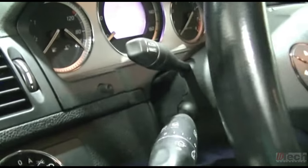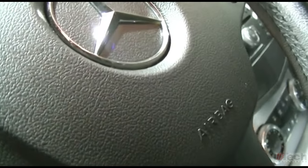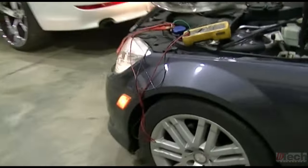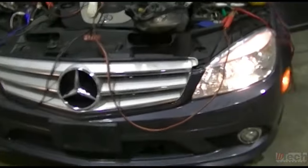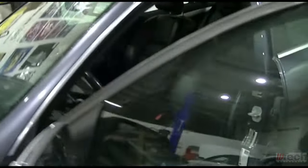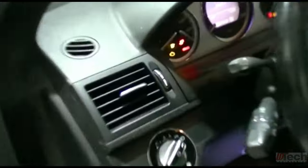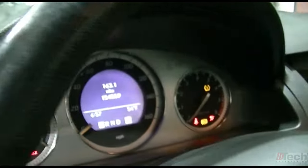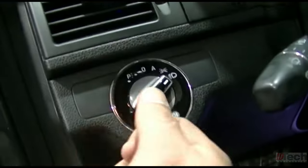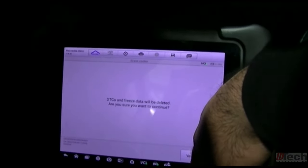Key it off, sit for a minute, and now we will key it back on. And we will operate the light. So both sides are now turning on with our bypass setup. And let's see if the SAM stays unhappy. Normally it would take a few key cycles, actually, or cycles of the switch for the message to pop on. It wouldn't even log a trouble code right away.